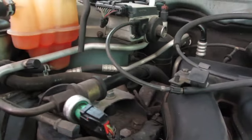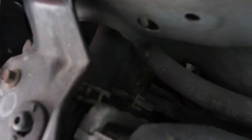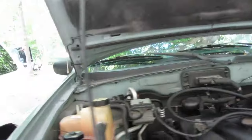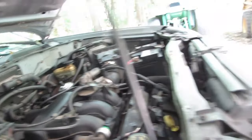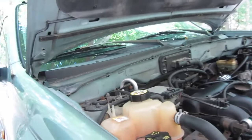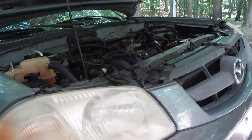I think the radiator is leaking from where the top hose goes in because it's a little wet under there. We may end up replacing a radiator after all — no big deal, it's like $120 and not very time consuming. I'm pretty sure it's just going to come straight out the top. Let's get a flashlight, some brake cleaner, and some paper towels and take a better look.